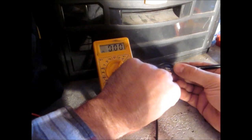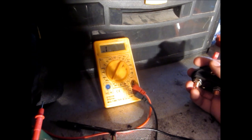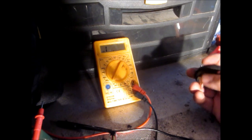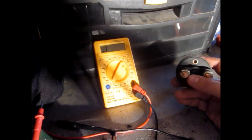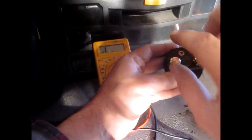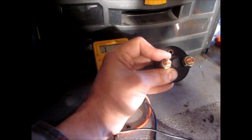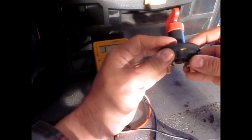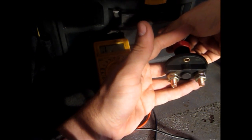So you want to find your negative battery terminal. There might be a couple of terminals coming out of the frame going to the battery. You find your negative terminal and make everything go into one side, then make a dedicated wire going back to the battery so you can just break it and complete the circuit whenever you want.